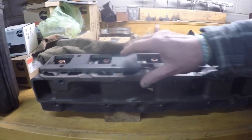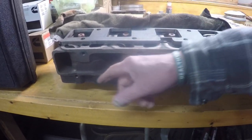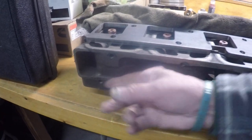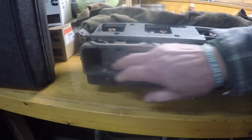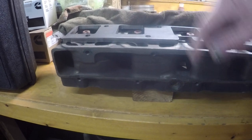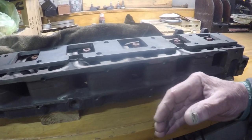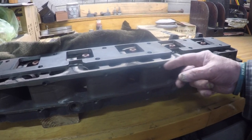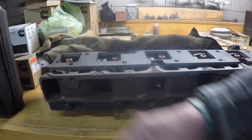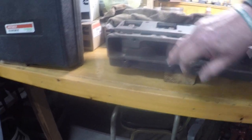This was just an experimental thing to see if I could do it and what was involved. One of the things I would have to do is take a fly cutter and cut this back a little further so I could stop any possible air passage between cylinders like one and two. Or, if I couldn't get a fly cutter in there, I could probably use a gasket to stop air seepage between cylinders.